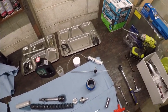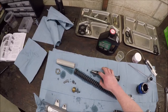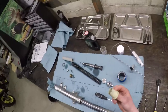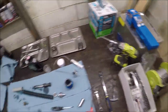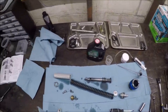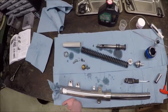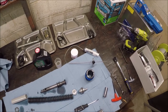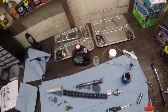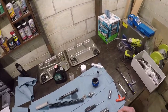I'm going to run 15 weight on this. I can see that I've got my damper rod drilled out to 10 millimeters, and the previous owner had taken the oil locks out - I'm fine with that, I don't want them in. I'm putting some All Balls seals in, which is kind of contentious because some people really don't like them, but I've never had an issue - every one I've ever put in is still not leaking.